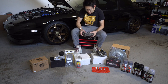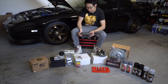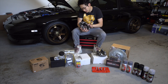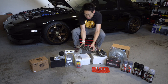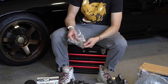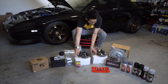I like the car to look kind of OEM, so I was looking for a brake kit that had the Nissan badge, but unfortunately this did not come with it — so we're going to be putting a Nissan sticker on there. The caliper comes from Rock Auto with all the hardware included: the pins, the shoe bracket, and the tie-down. You guys don't need to source any of the hardware separately. So that covers the calipers — direct bolt-on to the S13 chassis.